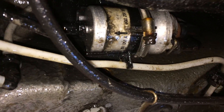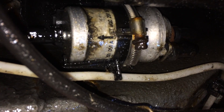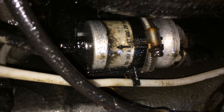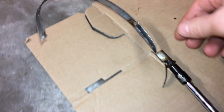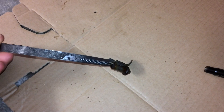Looks like we have to disconnect a clamp of some sort in the middle, then disconnect the lines, and then pop it out and put in the new one. I just tried to pull the clamp off the fuel filter using a quarter-inch socket on the strap, but it was so rusted on there at the head of the bolt that the whole clamp just twisted and broke. So we're going to have to find a new clamp to go on there afterwards — it's just a regular hose clamp, so that'll be okay.